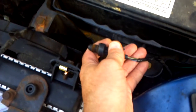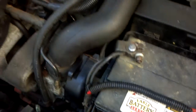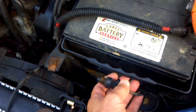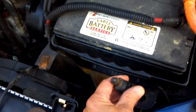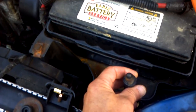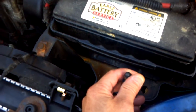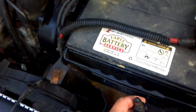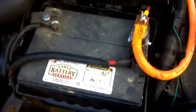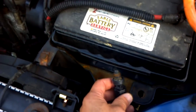What this thing is — this right here — it is a battery temp sensor. What it's for is the alternator on these cars does not have a built-in regulator. The regulator is built into the ECU, into the car's computer. When the under-hood temp starts getting hot, the sensor gets warm and tells the computer to tell the voltage regulator to turn the voltage down. I have a high-powered car audio system and I do not want my voltage going down — I want it staying up right around 14 volts.